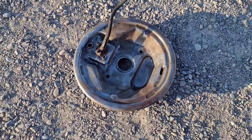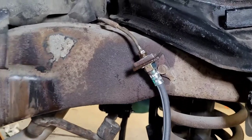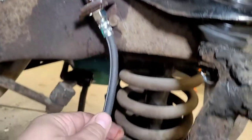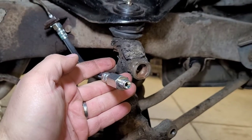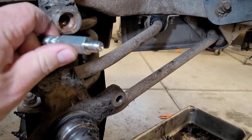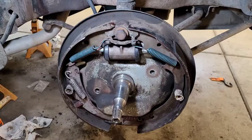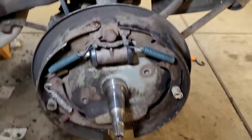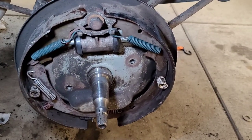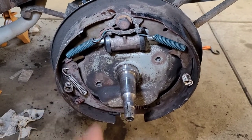A couple minutes with a wire wheel, got it degreased. We're going to throw some basic black Rust-Oleum at it — now it's all one color. I may be paying for this later, but I never did get the tube to come free of the nut. So basically I just spun the brake hose into the fitting and tightened it down and put it in place. Now when it comes to the wheel cylinder, we're just going to stuff it through the backing plate, thread the wheel cylinder onto it, and anchor it down. The paint is dry enough. I've got the backing plate with all the brake hardware on there. I still have two brake hoses back there — one's the new one, one's the old one — but it was easier to work with this when it was anchored to something. I'm going to set up the camera, grab the manual, and we're going to start taking this thing apart, finding all the right pieces and making sure we put it back together exactly the same way.